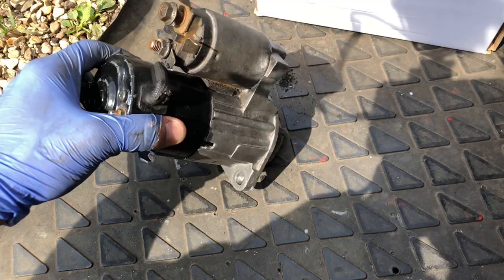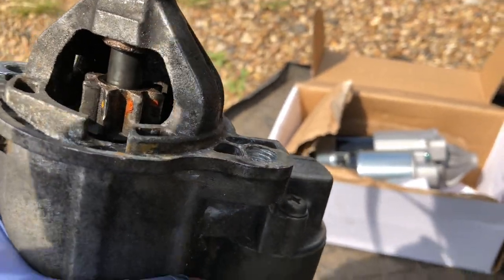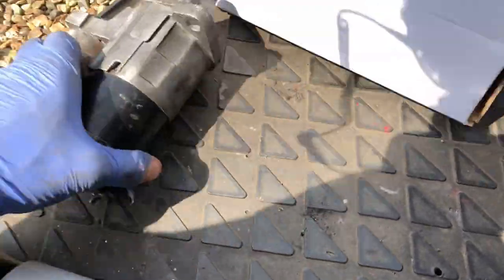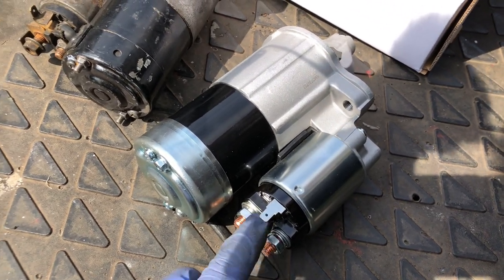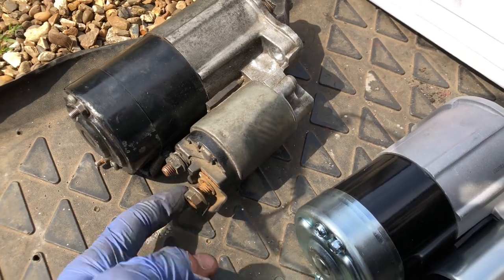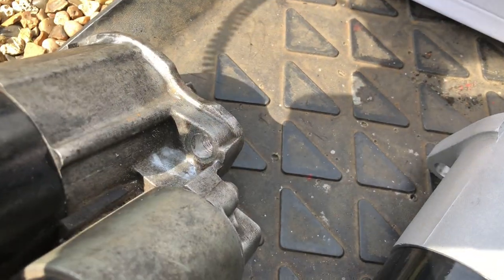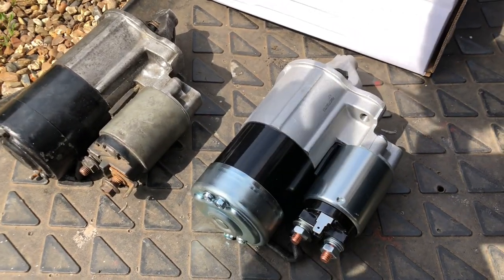The Evo's starter motor is absolutely cooked now - it sounds like a bag of old nails. Even after being taken apart and re-greased, it's absolutely knackered. You can see all the teeth are chewed up - it's an original unit and it's been on there forever. I went out and got a new unit - it's an OEM refurbished unit from a later model, exactly the same except the terminal that triggers the starter motor is on the top, whereas on the earlier models it's on the bottom. All they do is solder the plug into the top part instead of the bottom - very simple job. It's also got threads in the mounting rather than a nut and bolt going through, which is better since the old one had stripped threads.